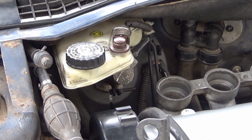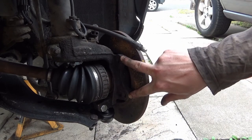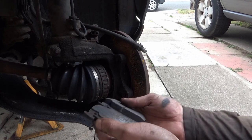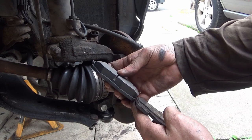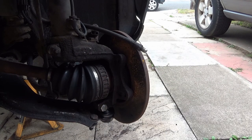Now we're going to move around to the side and put the brake caliper on. We've got to put this brake caliper onto this brake line, and then it'll go in these two points. First of all we've got to wind the caliper back. Just before the car went off the road, I was due to do a brake pad change on the front anyway. If you look at the brake material, you'll see there isn't anything left, so it was definitely due a brake change.